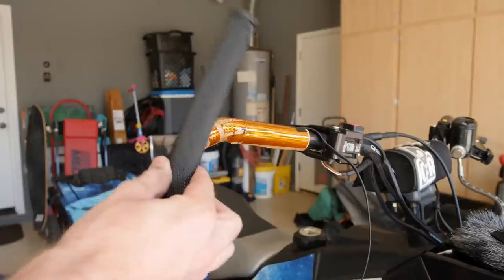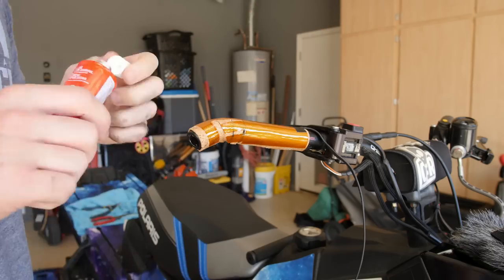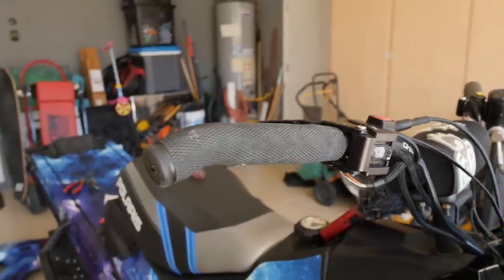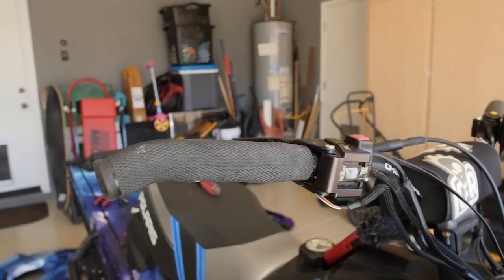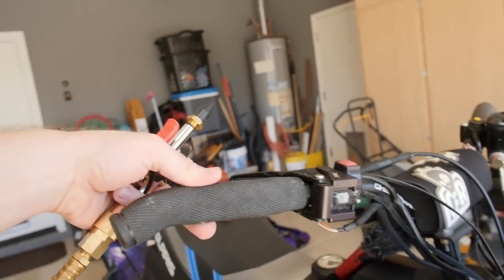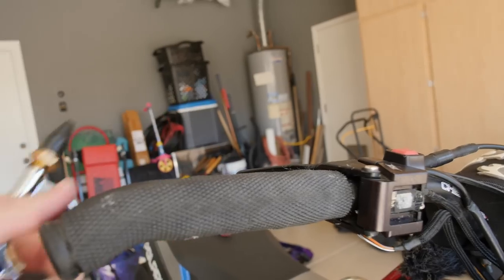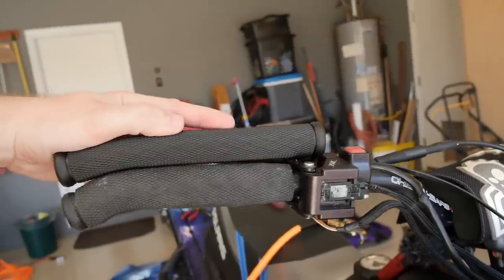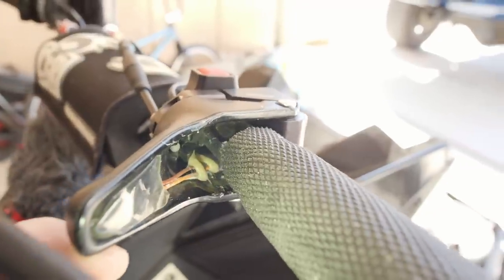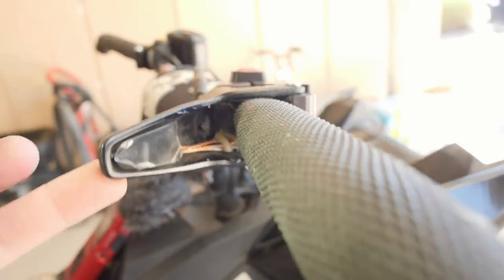Now our final step is the grip itself. You can tell it's going to have to be cut down, but that's why they give you such a long grip — you just cut it where you want it. I realized until I was almost done that I forgot to hit record, but essentially where the air comes in handy: use one hand to push the grip on and the other to work the air — that creates an air pocket between the handlebar and the grip, making it a lot easier to push on. You can also see I had to cut off quite a bit of the grip to fit it on there. The wire from the heater goes through my throttle block so it doesn't interfere with the throttle at all.